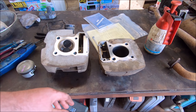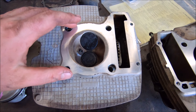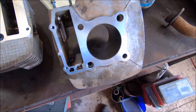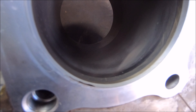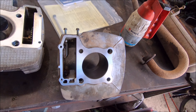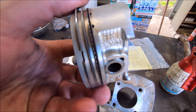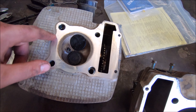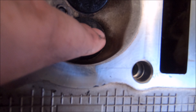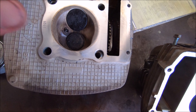Here's the head, cylinder, and piston - I've got it all out and apart now. Looking down there with the torch, there looks like a bit of pitting and rust marks - I think some water got in there at one point. Can't see much scoring, I can still see cross-hatching which is a good sign. Looking at the piston as well, I'm not noticing anything that jumps out to me as a sign of why it's using so much oil and sucking it up through the cylinder. The head looks all right, but I don't know if these valves are leaking. There's a lot of built-up carbon on the exhaust valve and I'm not sure if they're leaking.